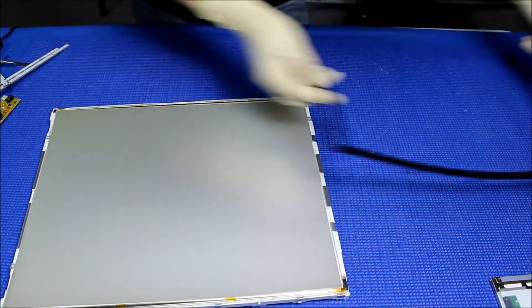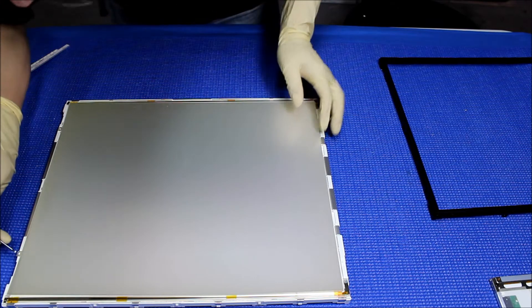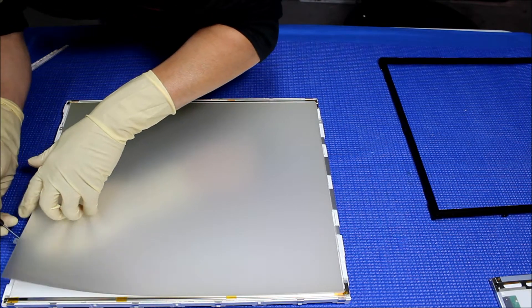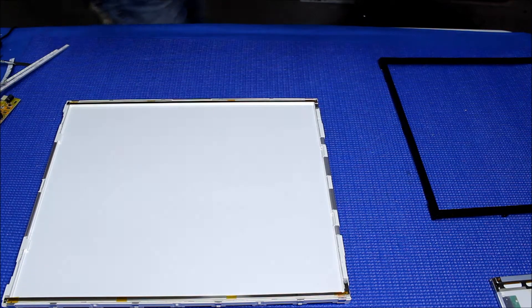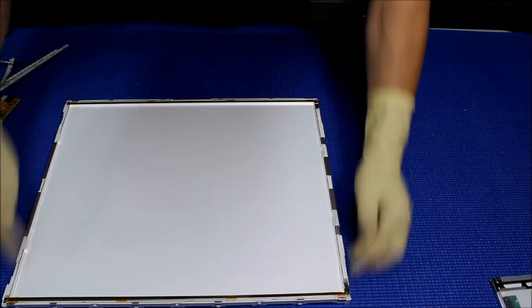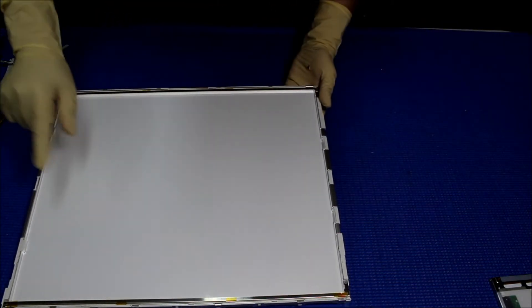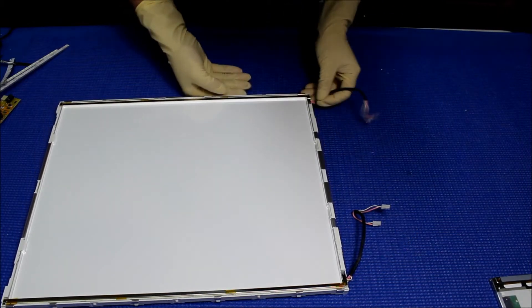We took it out already. Here's what I usually do — I'm going to get a whole stack of these diffuser sheets. There's a marking here so you don't have to worry too much. Usually three sheets. Lay the whole stack on top of the liquid glass and set it aside. Now we can see the backlight lamp. You can see the lid, the backlight lamp, and then the Plexiglas. We need to move this cable here.